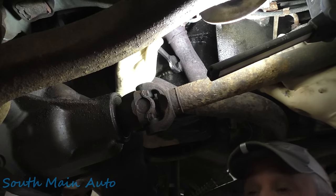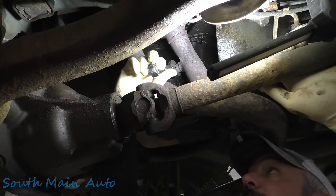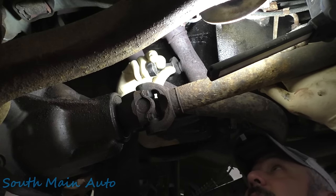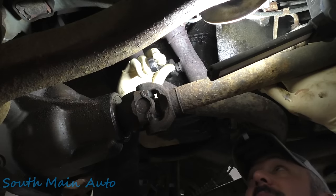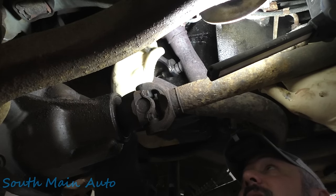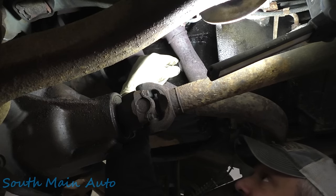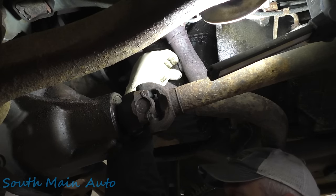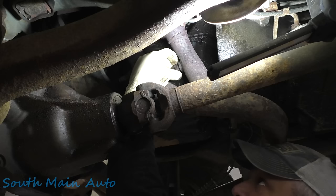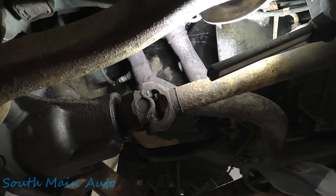I've had best luck in my career doing oxygen sensors when they're stone cold. Rarely do I heat one. Once in a while, but I find if you heat them, usually it doesn't end well. Threads come with them. I try to do them stone cold. Even if I just start it up to bring it inside and it's technically cold, just that little bit of heat doesn't usually help. Usually makes it worse. So I wait for them to cool right down.